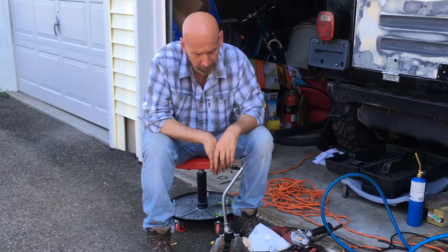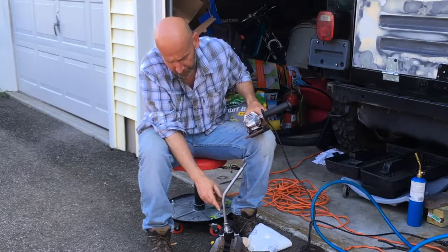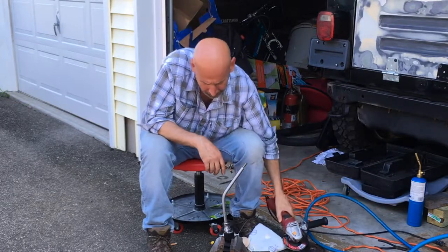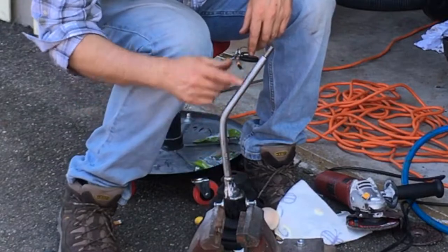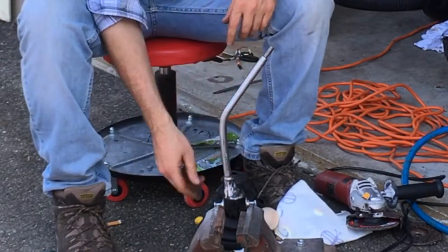Okay, we're getting pretty close. Now, I got the look I wanted on the shifter. I took the paint off, but I used an aluminum oxide flat disc. If you just go from the top and follow the curve down, and start making lines and keep on going around, you'll get this cool swirl pattern. And that's how I got this pattern.